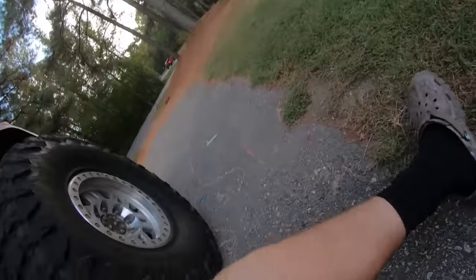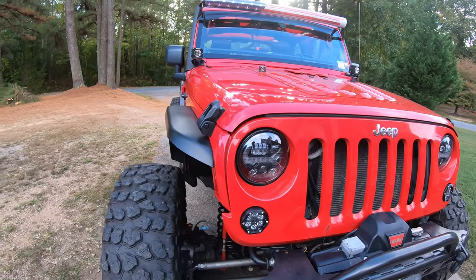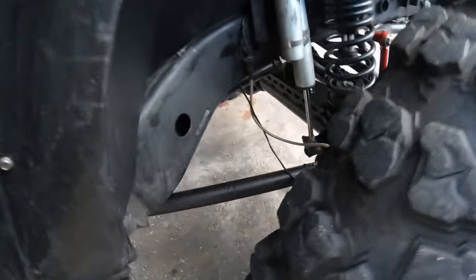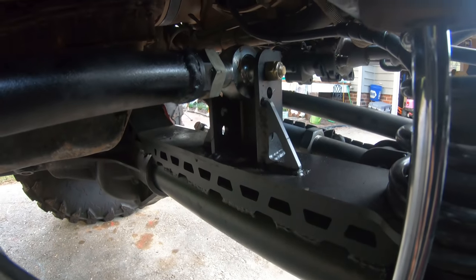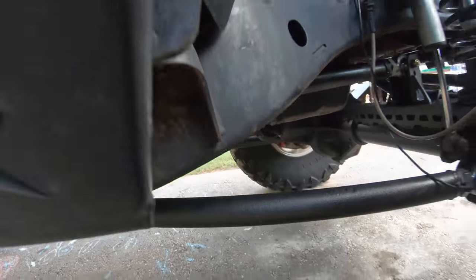I've already done a little flex testing because I wanted to make sure everything worked and that I don't have to move the catalytic converter. It is so close — about a quarter inch away from that upper link hitting the cat — but I don't have to move it. It might rub it and I could move it in the future, but it's not something I have to do right now. Even if I did, it's about $100 at an exhaust shop. That bracket up there is definitely really beefy and strong, and our control arm angles are so much better now.